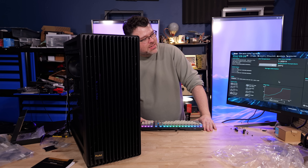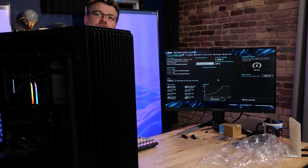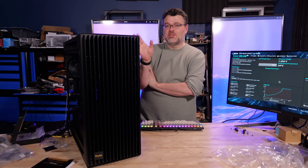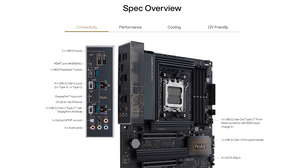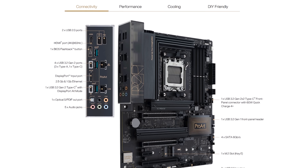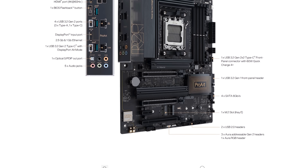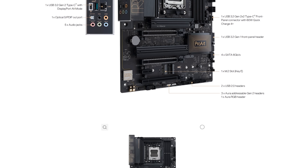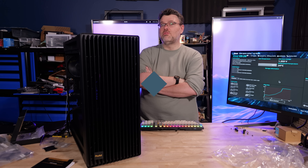That's been a quick look at the ProArt X670E. If you're thinking should I get the X670E — only if you need 10-gigabit Ethernet. If you don't need 10 gigabit, you don't need this board; that's most of the cost. Get the B650 version instead and save a bunch of money. You don't have as many ports and some other features, but most of what you're paying for is the premium of the Asus name — and also onboard 10-gigabit Ethernet, which saves you a slot. I'm signing out and you can find me at the Level 1 forums.